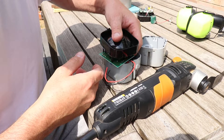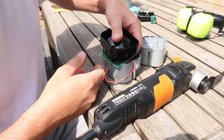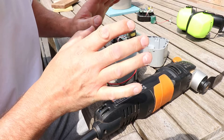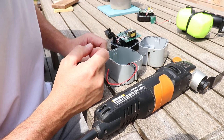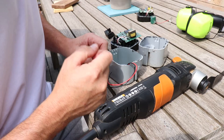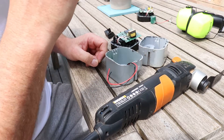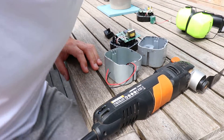Then glue it back together with some epoxy, or just some insulating tape should be fine, then put it back on the car and let it charge for maybe four or five hours. The alarm system service message should then disappear — there's no reprogramming required or anything like that. Just leave the car for a few hours and come back and check that the error has gone from the instrument cluster.